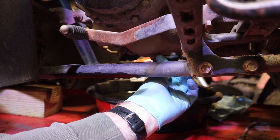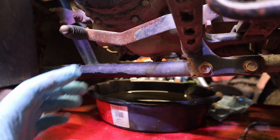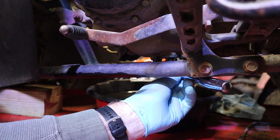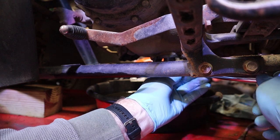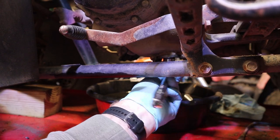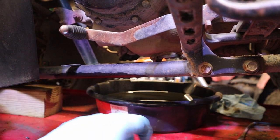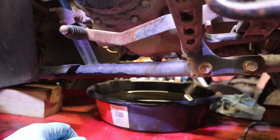And this just goes in, and I'm telling you fellas, gentlemen, this does not have to be that tight. It is a big plug on threads, and if you tighten it up too tight, you will crack that cap next to that O-ring just as sure as God made little green apples. Should have grabbed a long socket, I can tell you that right now. For what we're doing, this will be okay. Now then, that is tight against it. We only have to go a touch more. That's all it's going to take. You do a bunch more than that, you're going to run into problems. Let me come around here and give her just another tug. Yep, that'll do. There probably is a torque spec on this. If you don't know what tight is, please use a torque spec.